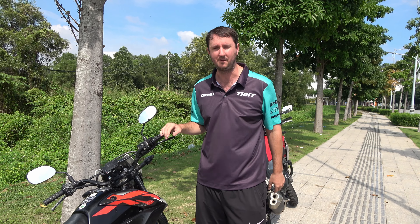Now if I tilt the bike back onto its kickstand you'll see it looks like it has no oil. If I bring it upright you can see the oil window comes to about halfway, and if I tilt it towards me the oil window is going to be full. So that's why it's really important to keep the bike flat. It does have a marker on here to tell you where the oil level should be, but as a general rule these glass windows should be about three quarters full. If you've got too much oil it's not a big deal but it can cause you to blow gaskets, especially in dirt bikes. If you've got not enough oil this is a big deal and you need to do something about it.